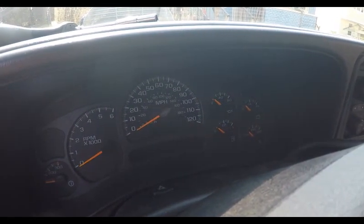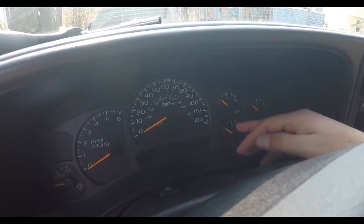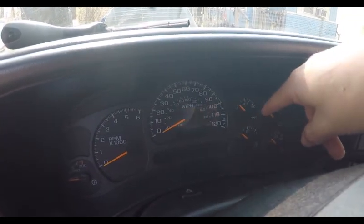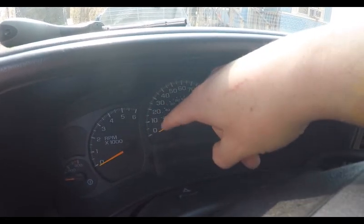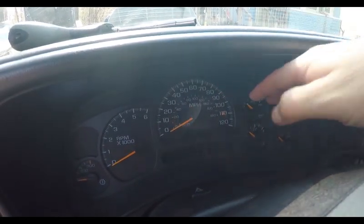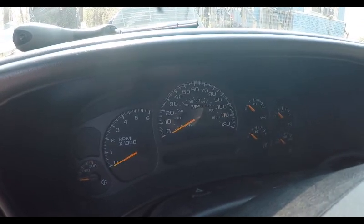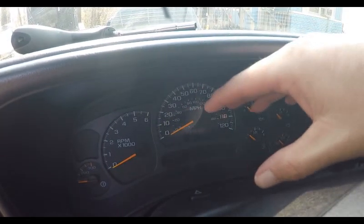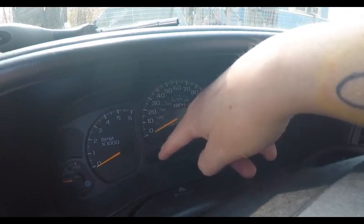Before the last time it went bad, these 4 gauges were actually pinned in the middle. Usually I've seen online the stepper motors go too. It's a known problem for GM. Usually it'll bury everything to max, and the car will be at 0, but it says you're going like 100 miles an hour. Mine doesn't do that. My cluster just goes out, and this won't light up, and this won't light up.